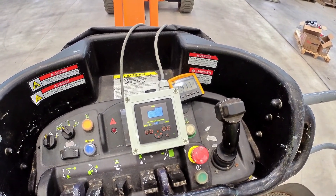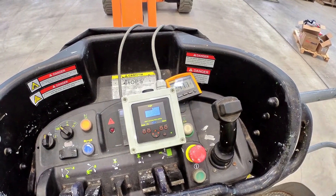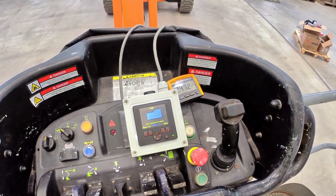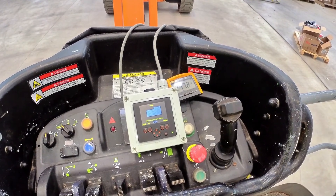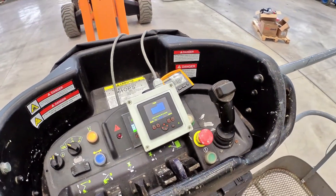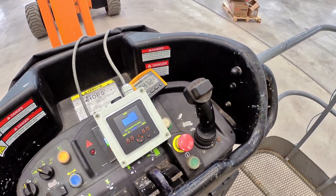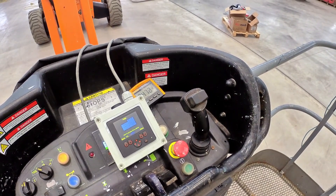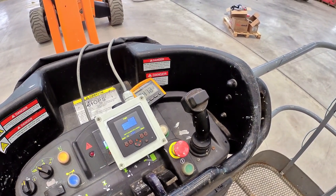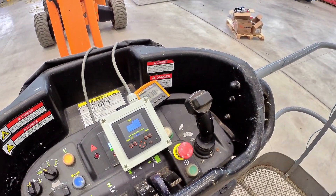So if the voltage is below 0.5 volts, the sensor is in fault; if the voltage is above 4.5 volts, the sensor is also in fault. At the moment, only when we're driving does the voltage go up to 5 volts. Not sure why it's doing that, so what I will try to do now is swap the cables on the sensors to see if the problem is coming from the sensor itself or somewhere else.